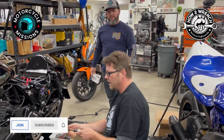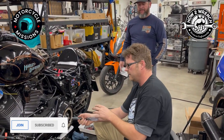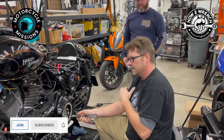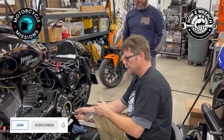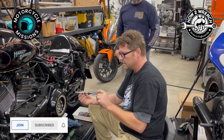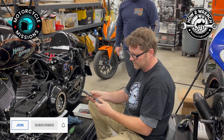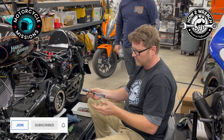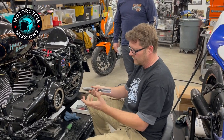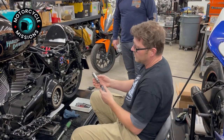There's our tip of the day for how to properly use the tools and torque per the manufacturer. I don't necessarily want to be the engineer — if I'm given a good value, I want to use it. This is a cool way to accomplish that without a million dollars worth of tools. The driver was probably $7 or $10 from a hardware store, the socket maybe $5, and we welded up a nut. Pretty cool — we can do it the right way.